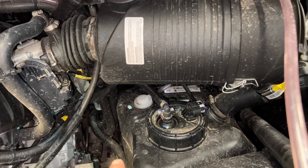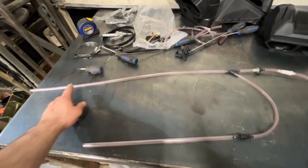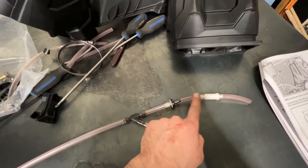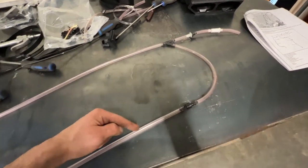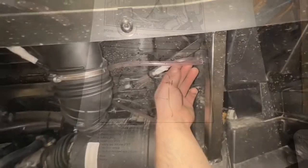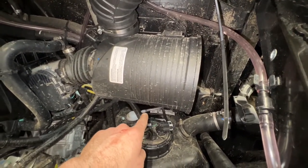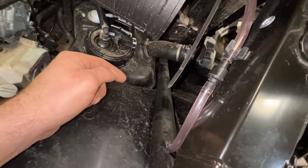Here is the new hose that I fed up from the water pump behind the new air duct and into the side wall. Next I need to remove the fuel line vent hose — I'm going to disconnect it from that fitting and pull it out the top. I have 720 mils going to the Y, 70 mils going to the one-way check valve. Make sure the one-way check valve only allows air to go that way and not back into the tank. Another 70 mils into the filter and another 70 mils that will attach to the machine. I have 310 mils going down to the one-way check valve and 400 mils down here. If all of that sounds confusing, just go to your instructions and follow the chart. I routed the hose — hooked the end with the filter up right beside the water line, ran it down behind the airbox, and hooked the long end with the 720 mil up to the top of the fuel tank. The other end coming off the Y with our relief valve feeds down into the frame where the original breather came from.